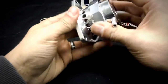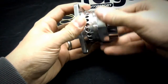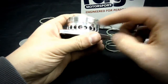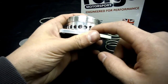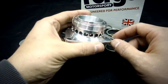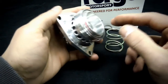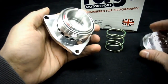Other than that, there's very little maintenance needed besides keeping the piston inside well lubricated, which is something that Forge does from the factory. They put assembly lube or a type of grease inside — just make sure that's greased up. Check that every two or three oil changes; you don't want the valve to stick or have any binding, especially when it's trying to discharge.